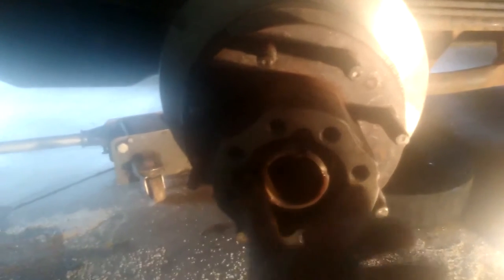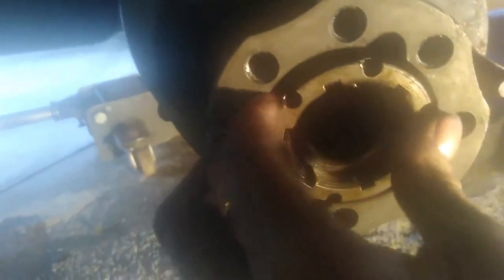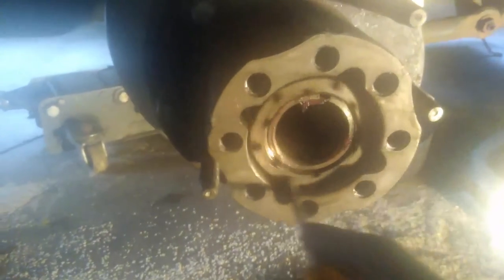You can get your brake cleaner, spray the rotor face down, and wipe off any fingerprints. Then we're going to start threading this back in and putting our keyway and everything back in here. Remember, we had counted the threads earlier — I had six or seven showing. Put this back on with the side that has the little U-shaped indentations facing out. Jiggle it to get it started — definitely don't cross-thread it. You can do a lot of it with your fingers but at some point you'll need a screwdriver to keep turning it.